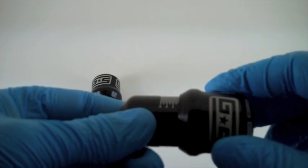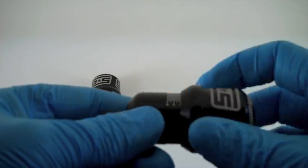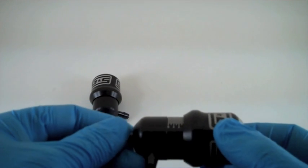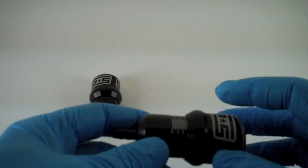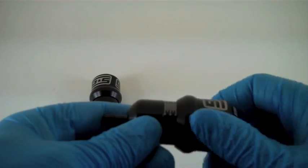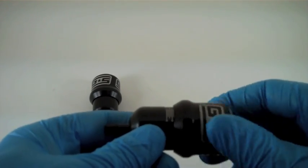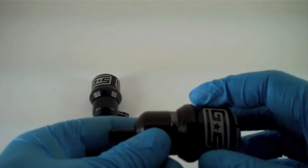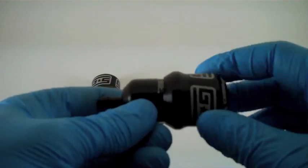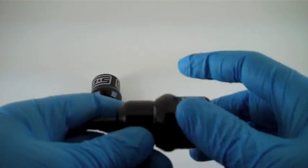You can hear the clicking. You can go as fast as you want, backwards or forward, and if you follow the scale you can dial it to exactly where you want it. In the fully closed position we'll go down the range. This is over 250-way adjustable. One full revolution is 16 clicks, and each click is associated to about a quarter of a PSI. One full revolution will bring you down one line exactly — so 16 clicks per line.